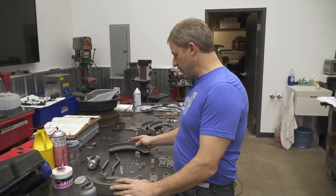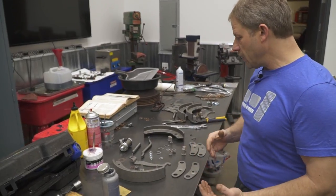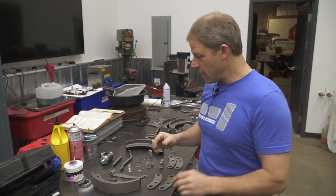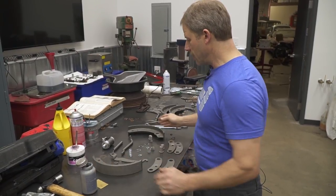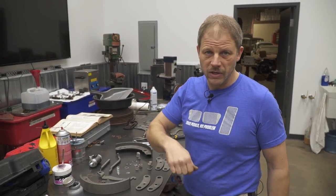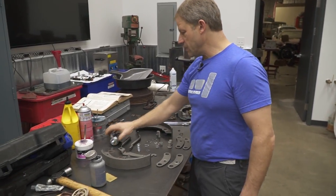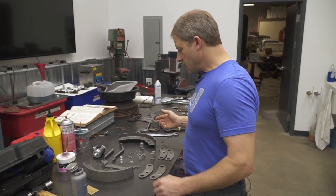On the modern brakes they're self-adjusting. On the older ones they're non-self-adjusting, meaning when you back up or apply the park brake they do not self-adjust for wear — meaning taking up the gap relative to the shoe to the drum. On these you have to actually manually go in, and part of the maintenance routine would be to manually adjust the brake cylinders so that the brake is taken up and you have a nice firm pedal.